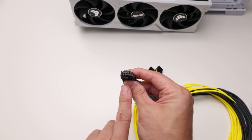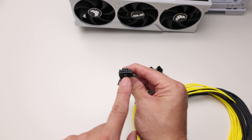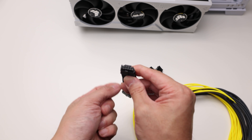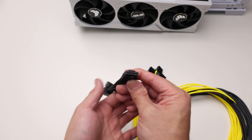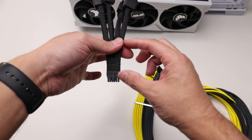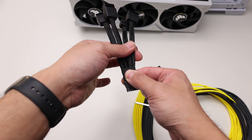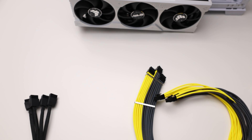So what can you do? When you get your cable, make sure all the pins are facing the same direction — it looks like a U. If one of them is in the wrong position, like upside down, that means that pin is not inserted correctly and could come out really easily. Make sure they're all uniformly distant from the edge. If you see one that's hanging off, don't use the cable — replace the cable. It's that simple. Check your cables before you use them. When you plug in your GPU, try to maintain that three to four centimeter clearance — even just go past the tape a little bit. Hold it in place when you connect your other stuff. Don't let this area get bent. Just common sense steps to prevent it from happening to you. Thanks for watching and take care.